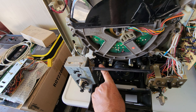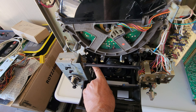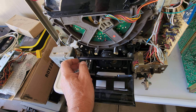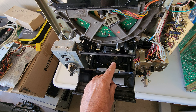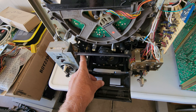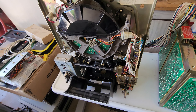It's like a switch — when there's no light it goes off, and when there's light it shuts off. It's a photo sensor that protrudes through the center of the cassette. I was doing some testing with the cassette I had in here, covering up this sensor, and it wasn't doing anything. Plus, it was going beyond the clear leader, which indicates that sensor isn't any good, because it should stop as soon as it sees that little silver tab. That's probably the indicator of why it isn't going into the load position — the sensor is not telling the unit there's a cassette in there.